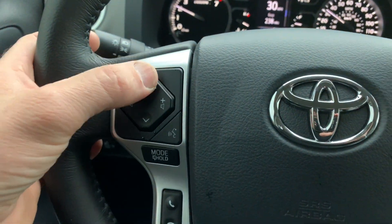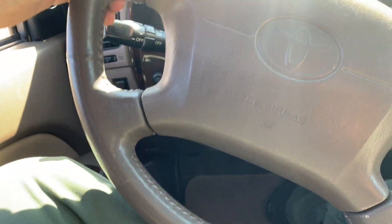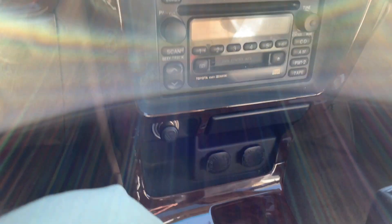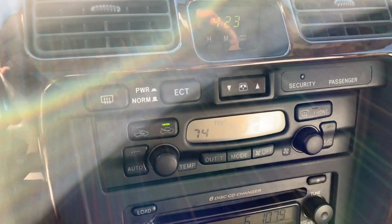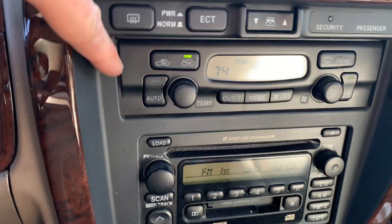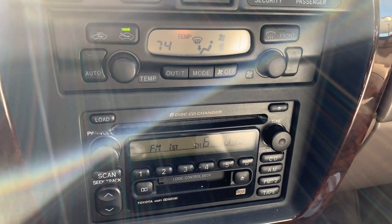No automatic controls, just the old knobs — but they never work; they're all broken. So if you're going to buy a 4Runner, plan on this whole HVAC control unit being broken. Take it out and send it in to have the contact points soldered. The headlights are on but the backlighting is out — the bulbs are out — so when you're going down the road in the dark it's hard to tell what your fan speed or temperature is. Not very convenient.